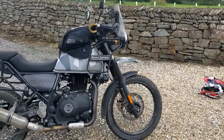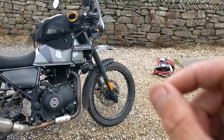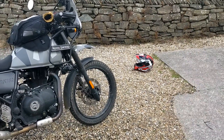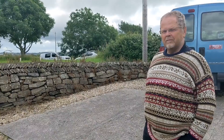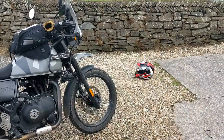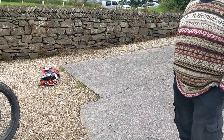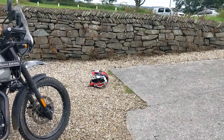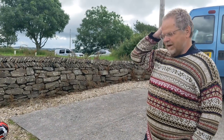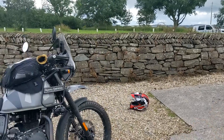You start thinking about what's making the difference - the booster plug makes a little difference, the iridium plug makes a bit of difference to how it runs low down. But I think what you find is it's got surge - immediate surge on the throttle. Even on these lanes it's got pickup whereas the other bike would accelerate but doesn't pick up quite as clean or as fast. It's hard to say whether it's actually four brake horsepower or 20 percent more powerful, but it definitely feels like it has more low-down torque. It's smoother and it makes overtaking a possibility rather than just sitting behind traffic.